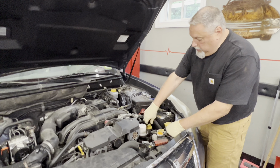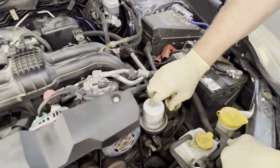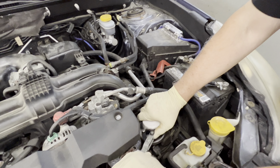Let's get rolling. We're gonna crack our oil cap loose just for now, but I'm not gonna pull it off yet because I'm gonna go ahead and do the oil filter first. It's right here — a little tiny one, that's a nice easy one.